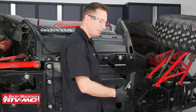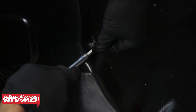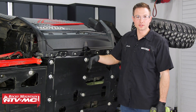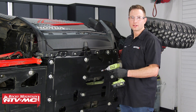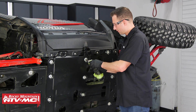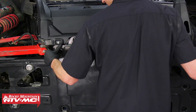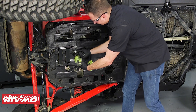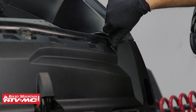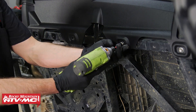Once you have access to your skid plate, the next step is to remove the middle and rear skid sections. We have four trim clips in the front — remove those first. Next, remove all the hardware holding the mid and rear skid plate in place; these are 10 millimeter heads. When you go to reassemble, put all hardware in by hand so you don't strip the threads. Note we're not reusing the hardware we're taking out, but you might wanna hang onto it as replacement hardware. Next, take out all the hardware holding the rocker panel in place and remove it. Keep in mind there are two trim clips inside the cab that need to be removed. Then do the same thing for the other rocker panel.